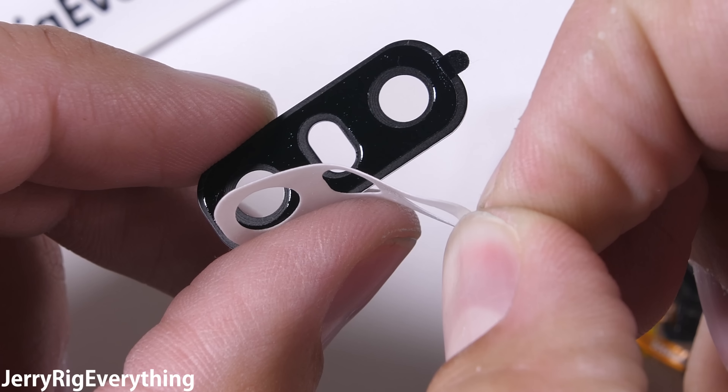A few final test pictures to make sure everything is clean and working. If the camera's taking blurry pictures or won't focus, make sure the glass you installed is clean and clear. If it still won't focus after that, it's probably dust that got inside the camera unit. Sometimes that'll clear up on its own after a few days, or you can try a few soft taps on the screen like we did earlier with the camera side face down — gravity will help jostle any glass dust out from the camera.